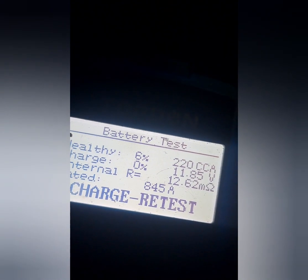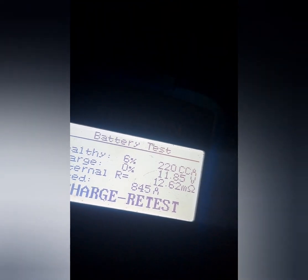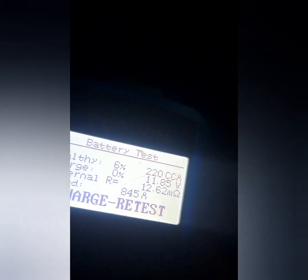It's a regular flooded around 800 CCA battery. It scores 220 CCA at 11.85 volts, but I've been driving it regularly and it should definitely have a lot more than that. All indications point to a flat battery, so we're going to try and get a battery put in and see how it goes.